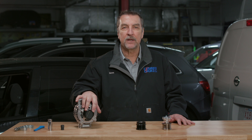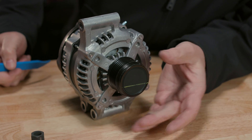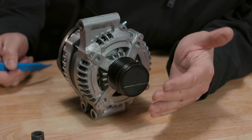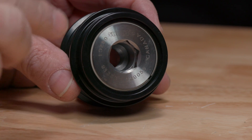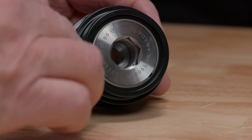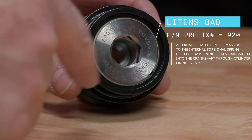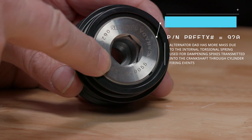Whether it has an OAP or an OAD, you should know how to tell which one it has. The first visual inspection item is to look for the presence of a rubber cap. Litens OADs use a rubber cap while most OAPs use a plastic cap, and OAPs are typically silver while OADs are black. If the cap is off the front of the pulley, look for a light-colored bushing — a white or yellowish bushing is a clear indication that this is an OAD. You may also have the Litens logo on the front, and a part number with a prefix of 92 is also indicative of an OAD.